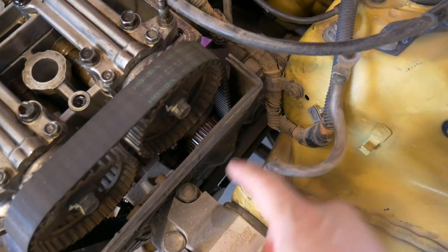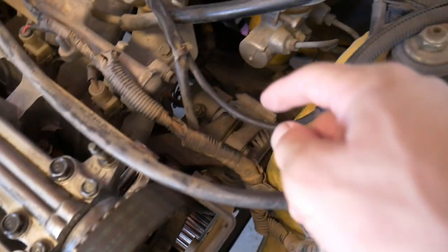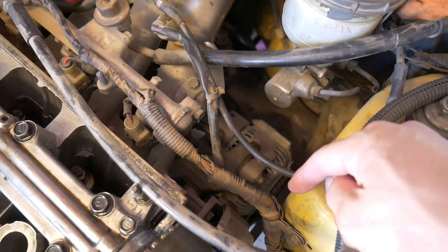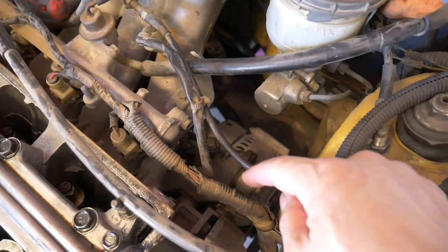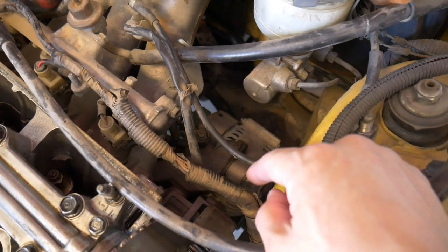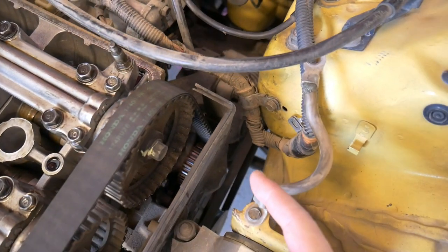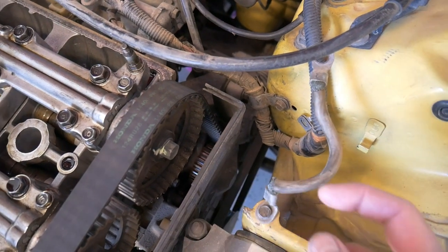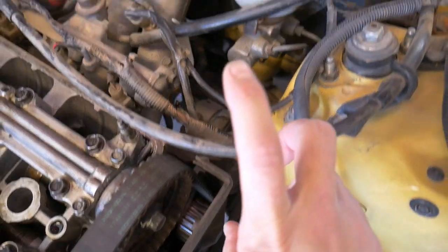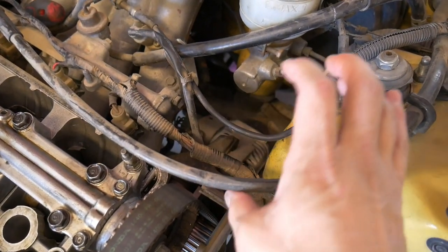All we have is just the alternator belt, which maybe you guys are familiar with how to do. You just loosen up, there's a bolt or nut. Sometimes there's different configurations of 12 and 14s. It should be a 12 on top here. Then on the bottom, right over here, you have the bolt which slides through, has a little squared end, it has a 14 millimeter nut here. Once you loosen up both those, that's how you tension the alternator back and forth.